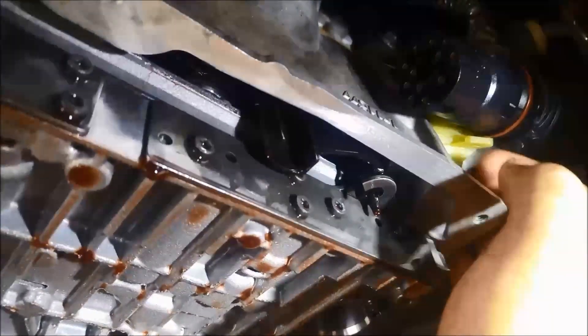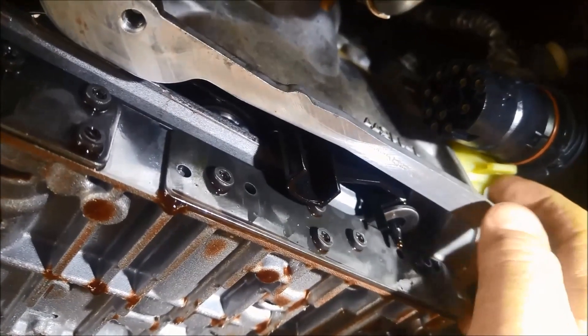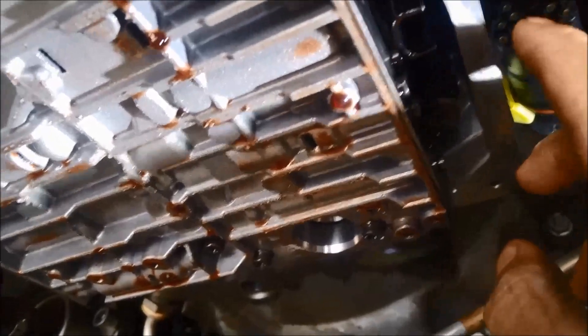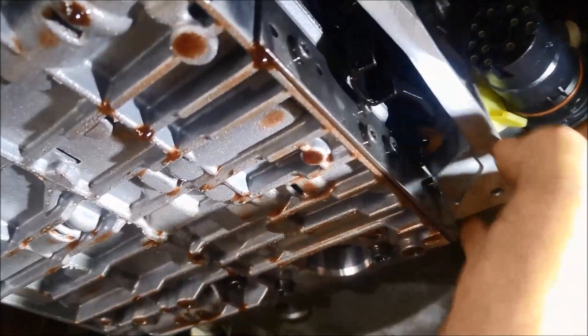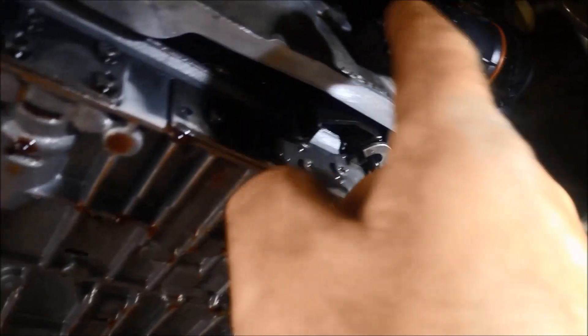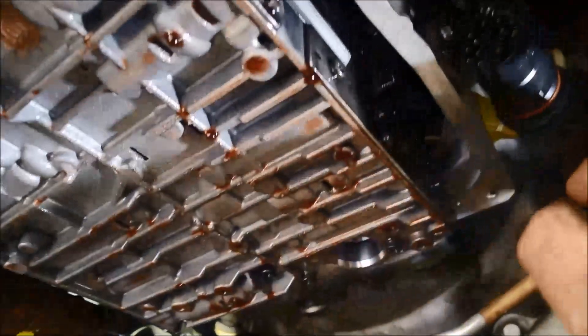Now I've blown out around here, around the plug. I'm just going to give it a squirt of anti-corrosion WD-40 or CRC, and then you push it in. Then that little tag — as you just have a little bit of pressure pushing it in — it'll catch on that winding on that thread and it'll just pull that plug in by itself. Just wiggle it in — it'll find its own little spot and goes straight in. Another thing: when these seals go on these, you can end up with oil under your dash. It'll squirt right up the loom and work its way all the way up, and you'll wonder where this transmission fluid is coming from under your dash.